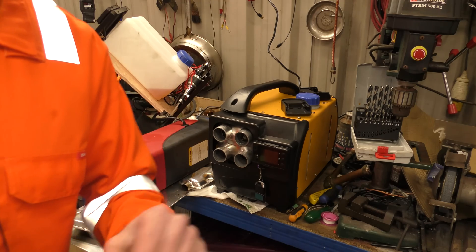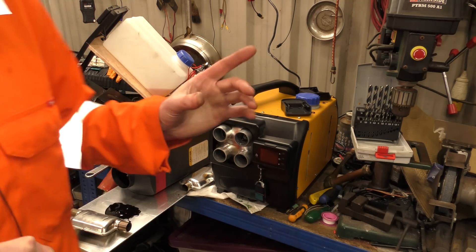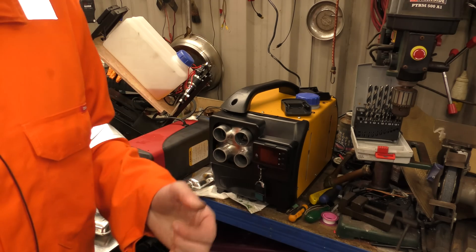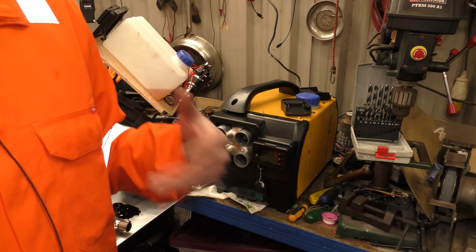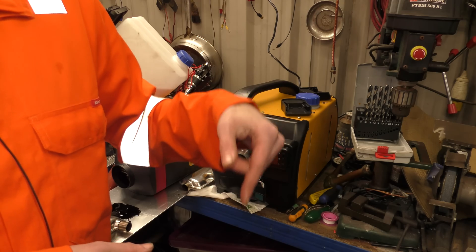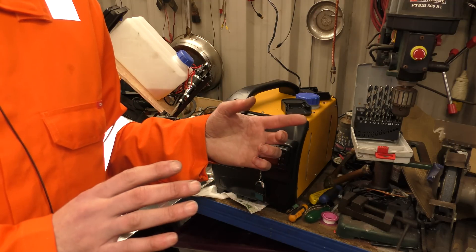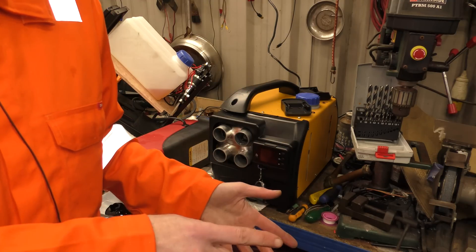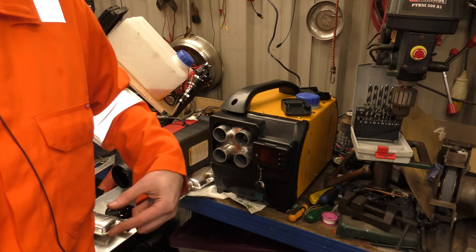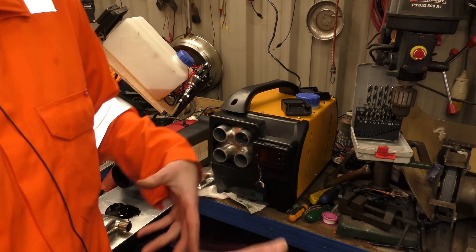At the moment that tumble dryer is powered by a mains-powered motor that does the spinning of the drum, and I'd like to replace that with something that is 12 volts. I'll eventually work out how to get the top off the tumble dryer so we can actually get into the motor. One of the things we want to do is change that so the whole thing can basically run at 12 volts. I think the fan that blows the air is on the same motor - it's just a fan on the end of the motor shaft, so we'll see once we get that far.